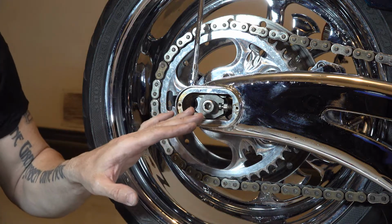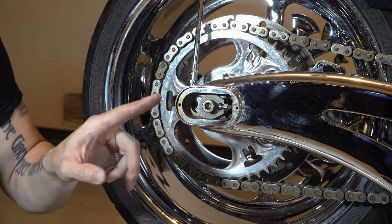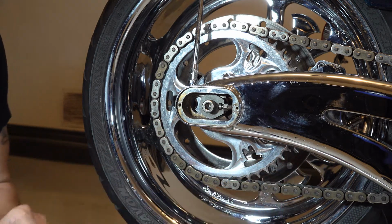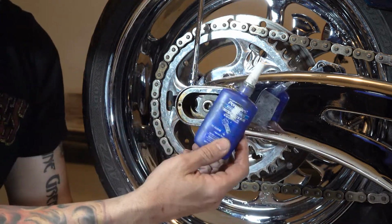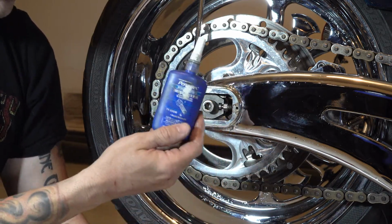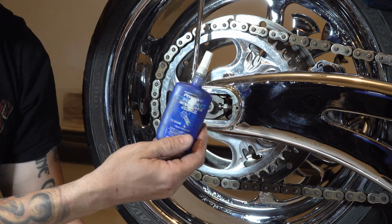Now that you know you have the axles even with the adjusters, the axles are tight, you have the brake mount tight if you had to loosen one, now you just have to put the axle covers back on. I like to use a little bit of blue Loctite on the screws for these. Lock tight, lock washers, lock nuts. If you ride a Harley or a chopper, these things are your friends and keep parts from vibrating off.